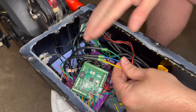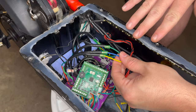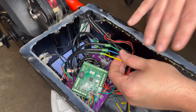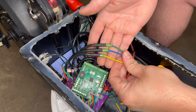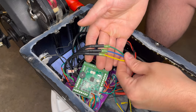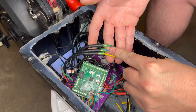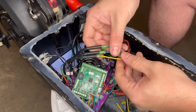This is where things get a little tricky. Under normal load nothing extreme, I believe everything will hold up fine. But I do want to caution you against turning the u-box up to super high power, turning the regen braking all the way up, and going for high-speed runs for long distances — because that's going to get to the point where your motor wires get hot. Normally your controller and battery will get warm after a long time, but if you push the limits you're going to end up with phase wires melting because these are stock. If you really need to push the limits, you're going to have to upgrade all the wiring — the battery wiring, probably the BMS, and all these phase wires, because these are maybe 16 gauge wire and they need more if you're going to be pushing the scooter super hard.